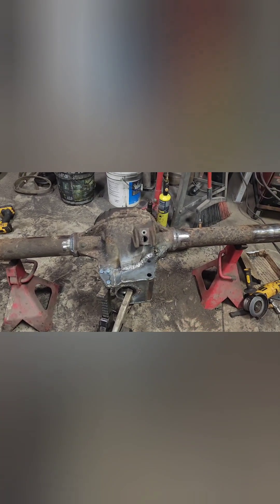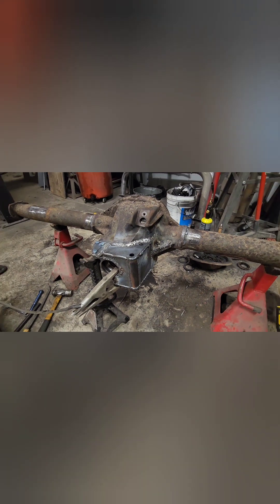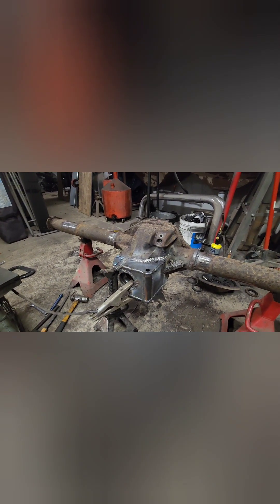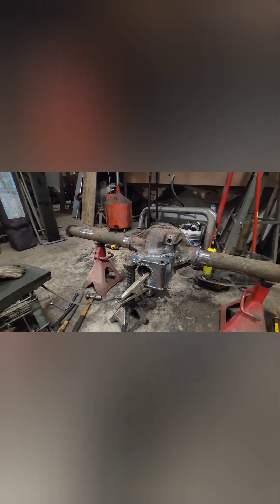Walk back here where I've been making more heat. I have not stick welded in I don't even know how long. Got the torch in there keeping it somewhat warm and slowly cooling it back down. I ran out of MAP gas on the other one because I gotta heat everything up so I can weld it. There are three passes all the way around — some of them don't look pretty, but I'll clean some of it up with a grinder. I'm not gonna clean up a lot of it because it's gonna be under the car and you're not gonna see it, but I'll know. I took a couple pictures — I'll put them in at the end of the video.